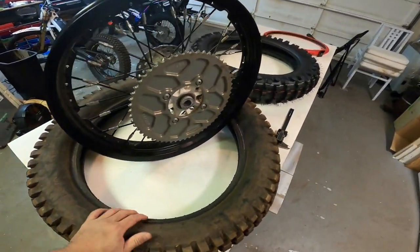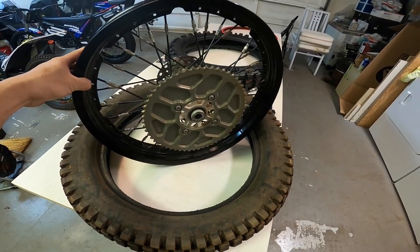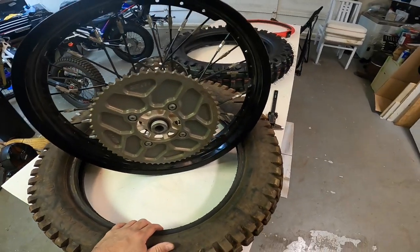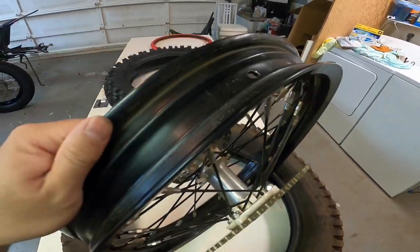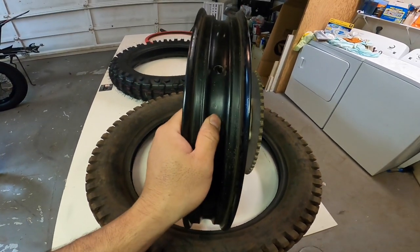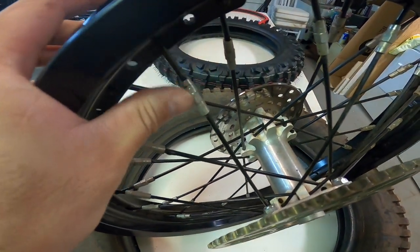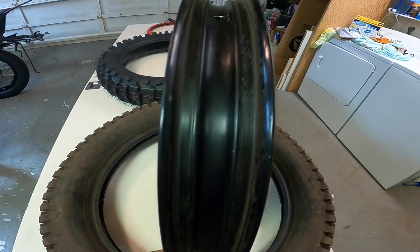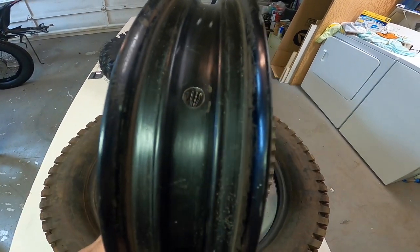The reason we're doing this video today is I've taken the leap of faith and removed my trials tire — which was a tubeless tire — off my solid trials competition wheel. This is not like a normal motorcycle enduro bike tire. The spokes are turnbuckle style, which leaves the wheel completely solid except for one hole where the Schrader valve went to fill the tire.